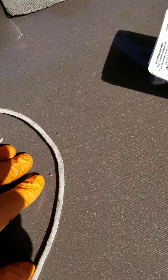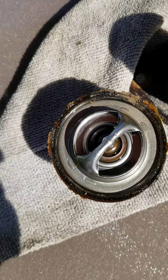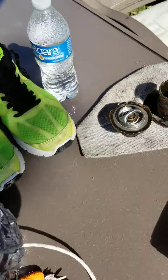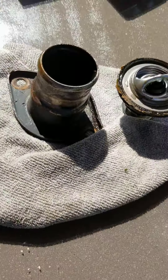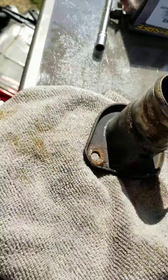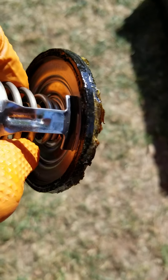Doing this water pump and thermostat — really quick visual. That's how you can tell you were getting seepage around the gasket. In the last video I showed you the bolt that had the seepage — that's that bolt there. Now you can see the wetness around it, but just to confirm it was seeping around and not coming from somewhere else, you can see that overlip right there.